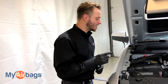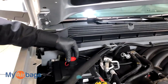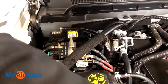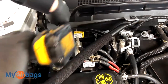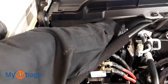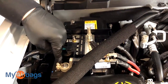The first and most important step is to disconnect the battery. Anytime we work with the airbag system — whether it's the airbag, the seat belt, or the airbag module — we want to make sure there's no power going into the car. Right here is the battery. Start by taking this case off — it pops and slides right off. Then take your 10 millimeter socket and start with the negative terminal. Loosen up that nut and wiggle it out, putting it completely to the side so there's no chance of it making contact.